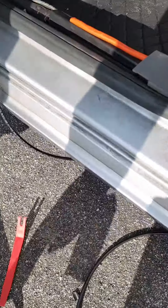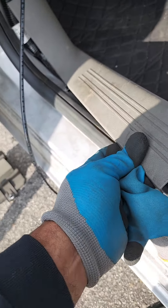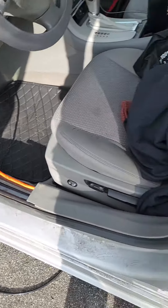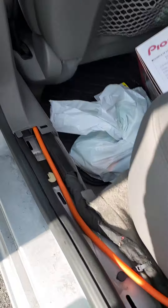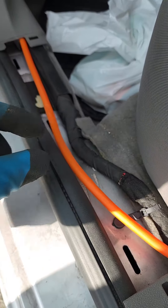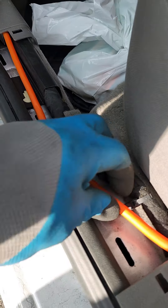I've already taken off this kick panel here — it goes up under there. I'm going to run this wire, tracing it the same way as the rest of this old bad 4 gauge CCA — copper clad aluminum — which isn't the best. Even somebody who knows nothing about wire could hold both in their hands and compare them. This one is so flimsy and the strands are so thin. The other is a little thinner overall but it's true 4 gauge. I'm going to just trace it through and pop it back into my amp.